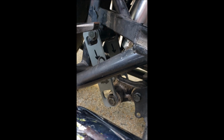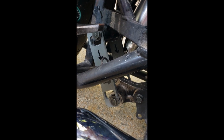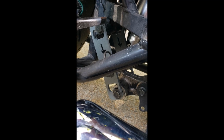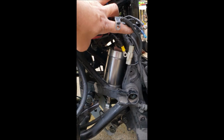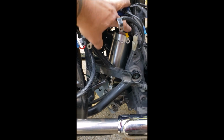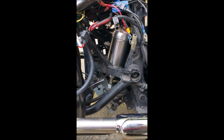And when I mounted it, I didn't like the ride height so much. So I have these Pacific Coast Cruisers lowering brackets, and I put those on. Thankfully, with the right tools for the right job, swapping out the stock dog bones to these lowering links only took about 10 minutes, but I have them down on their lowest setting, which is about a 2¼ inch drop, so it does have the height that I want. But it tucked in there really nicely and clean. So when I come back, I will have this cover put back on with the battery in place, and I will do a test to show you how it works.